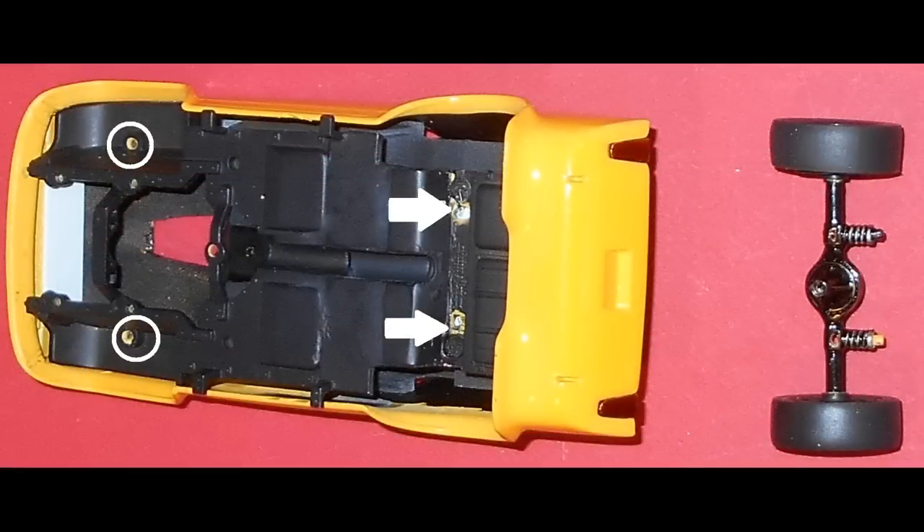The white circles show the holes where the front spindle is mounted on those tabs, and the arrows point to where the rear axle goes and where the coil spring tabs fit in. Those holes were kind of plugged so I had to use a drill and carefully drill those out to make sure I could fit the tabs in there for correct location.